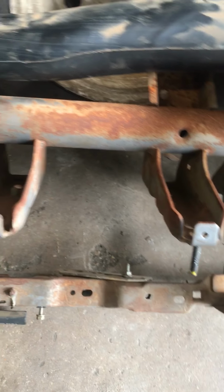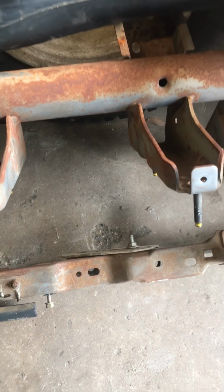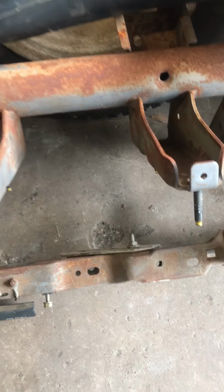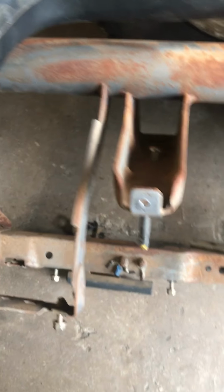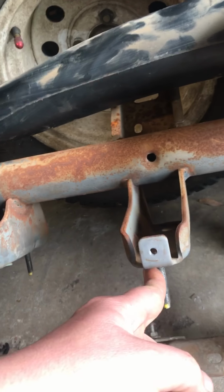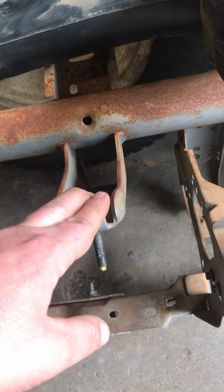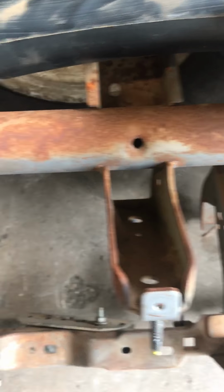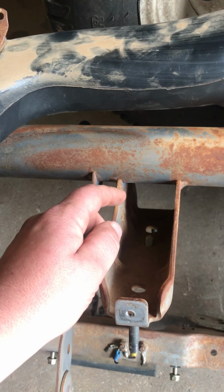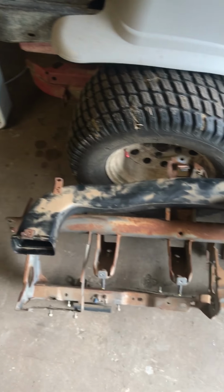You should probably take the steering column out before you take the dash out. I took the dash off with the steering column in. It was not fun. I probably should not have done that, but here's the bolts. They're 13mm bolts that connect your steering column to the dash support. All right, and then there's 2 more in the back. The bolts were 13mm, all of them. See? Boom. There's 4 of them, and then you disconnect that other bolt, the star bit.